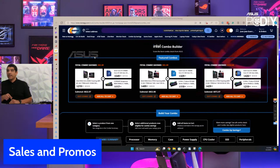Also, I'll give a soft plug. One cool thing, especially about the 14th Gen series processors, is you saw Intel recently announced that there will be forthcoming updates extending the Intel APO technology to prior generation CPUs. Originally it was released only to allow for performance enhancements for select games on the 14th gen series processors, but it's now being backported to prior generations. So you will be able to leverage APO in a wider range of games on other series processors. That's pretty cool because the performance uplift for APO is pretty notable. And if you're not aware, what APO is doing is an intelligent adjustment to how the processor works in relation to the game engine.